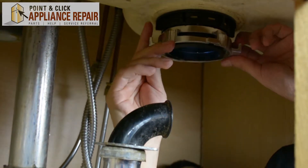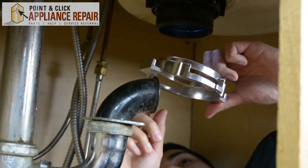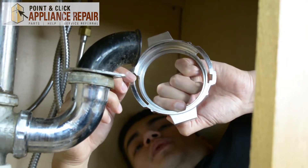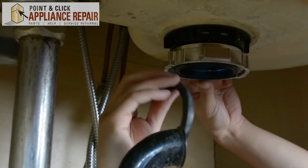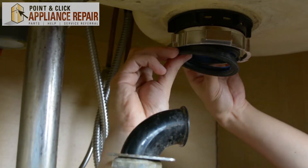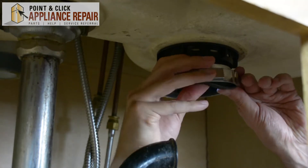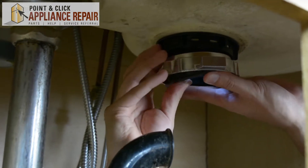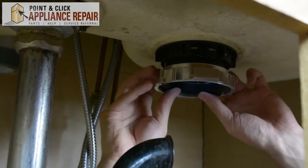Now we're putting this back up here, and you're going to want to make sure that you put it on the right way. You'll know it's the right way because the bottom here has this part that will connect onto your disposal. So you just put it right up in there, and then we'll get our rubber gasket. You're going to make sure you put it on the same way you took it off — this piece faces up with the widest part at the bottom. It might be a little bit difficult; you just have to work it around as best as you can, but it will snap into place just like that.